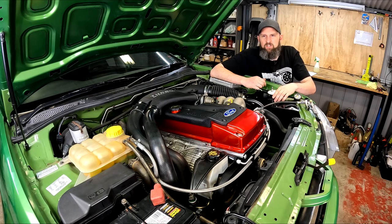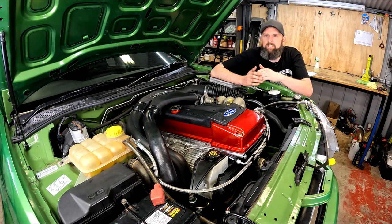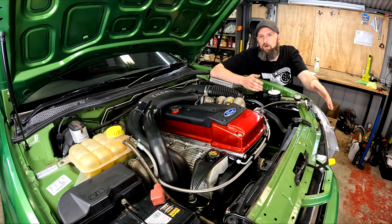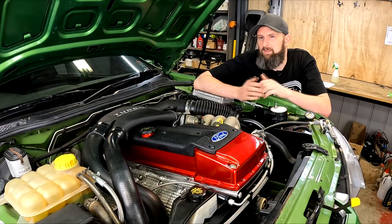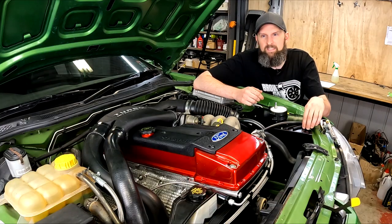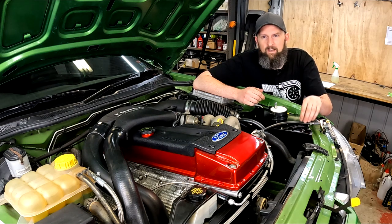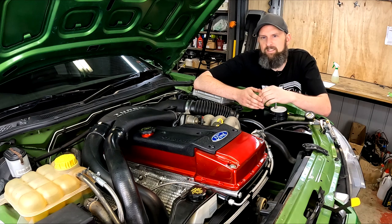So, that's our cheapo boost leak tester and how to use it. I'm no expert, but that all seemed to work pretty well. I hope that's helped some of you out. It's not a perfect replacement for actual driving conditions and won't move nearly as much air, obviously. So, the real test of hoses blowing off will be driving it. But it's a good test, and just as well we did it, because that vacuum leak or boost leak for the fuel regulator could have really caused some serious issues.